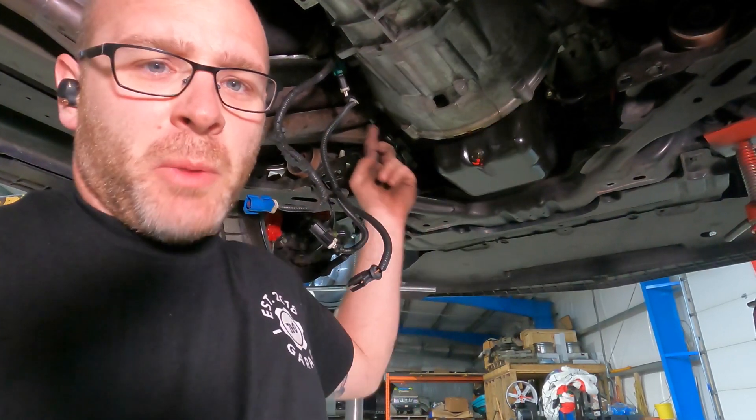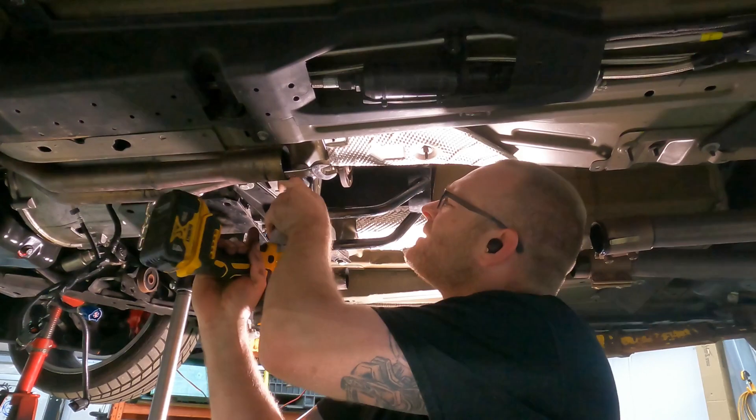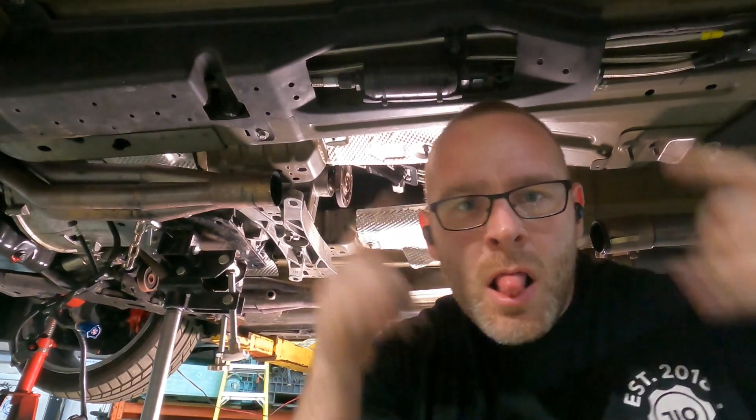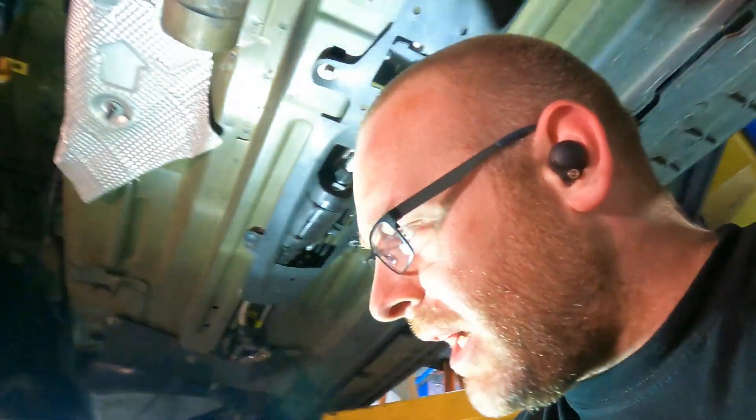We got that cross member out — took out the two bottom bolts and the next two up. We need to undo the starter and get it out of the way. Then we'll go up and pull that shifter, and we can start pivoting this sucker down. Let's get the transmission jack under there and get ready. Now we can get to the top bolts of the trans with our really long extension. You can see that black cap right there above my finger — that's your clutch hydraulic line. There's a little silver clip right there and we're going to pull it out toward the driver's side door and then that thing pops off. That's the last thing we've got to do.